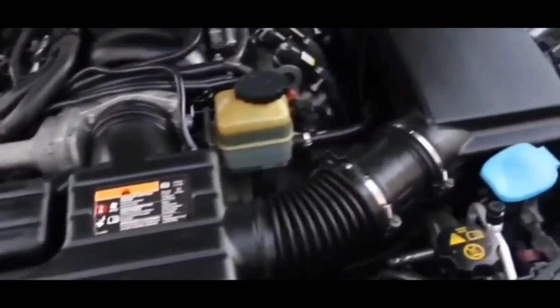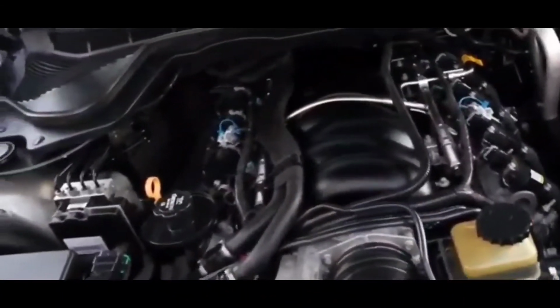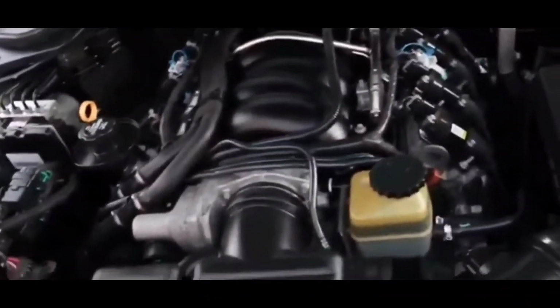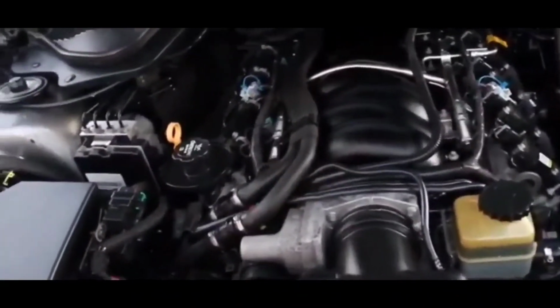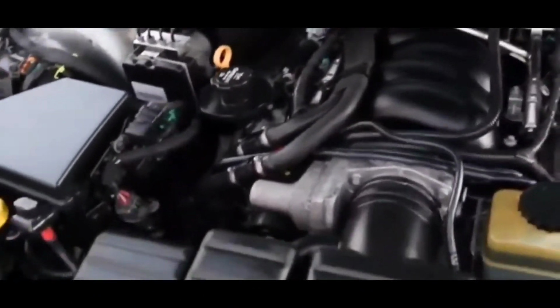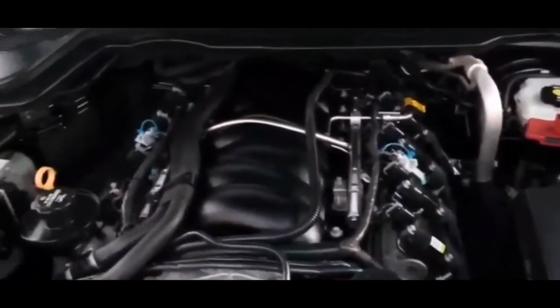So, there's nothing else I could check out, I don't think. The fuses, the relay, the battery is good. Somebody gave me a jump, so electricity was applied to it. At this point, the only thing I could do is to go out and try to bump the starter.